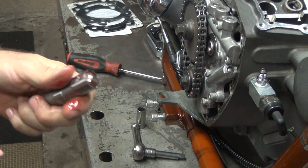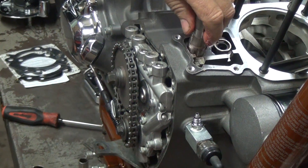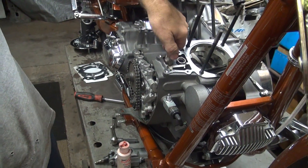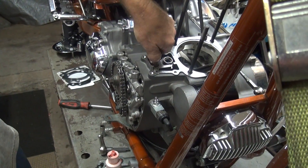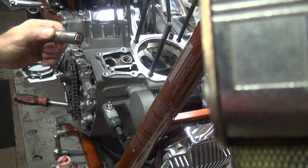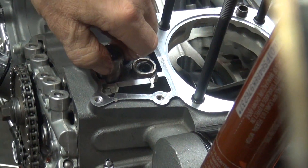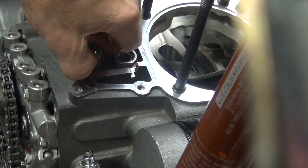There's something yellow flashing in the middle of it there. That battery? The camera? Yeah — probably means the battery's getting dead. That means I gotta do a battery swap. Or we quit videoing. I can't quit in the middle of the job. See how that lifter does not want to go in the hole? I noticed that — that's not good. Too tight? That's a little snug. Anything in the hole? It just doesn't like you. So your blocks are really tight — very low mileage on them.